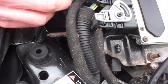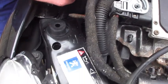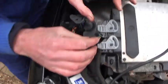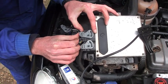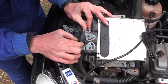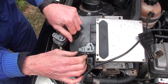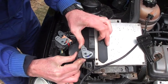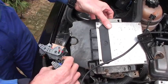We're taking out the engine management unit — these clips are held like that, and out comes this one. It's got wires: the longer one goes to the start. Taking out the connectors — they probably only go in one way anyway. One has an orangey fitting — that's the centre one. So that one distinguishes itself. You can't get those muddled up.